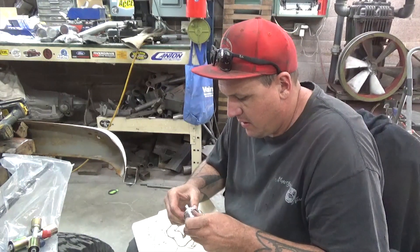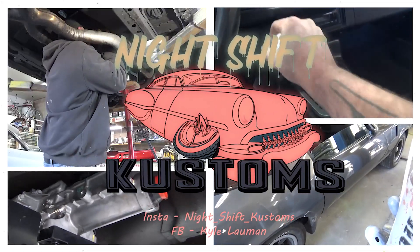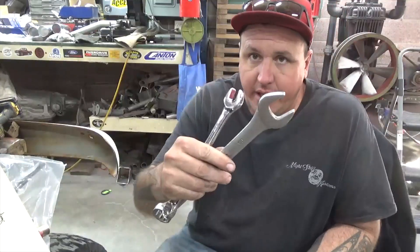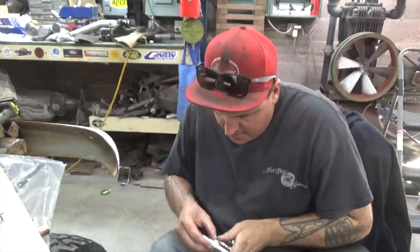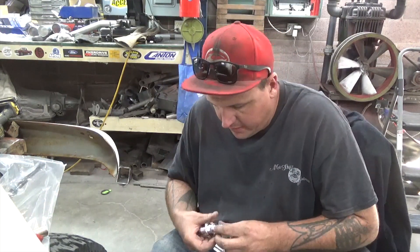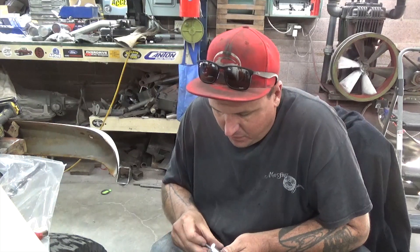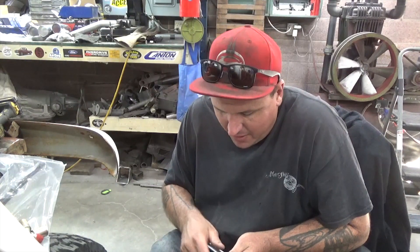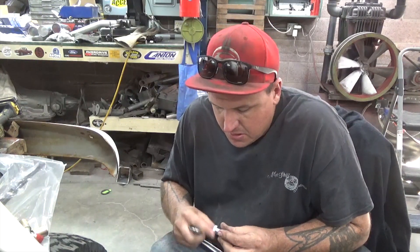Then you're going to take your one inch and your three quarter inch wrench and loosen up the nuts that hold this together. Set these on the tire and loosen them. They're the same size, that's a good start. You never know what they paint them with though. Some of the pieces are powder coated and it doesn't work for your sizes or your threads. Some of them have some terrible black paint that comes off immediately, like the black lug nuts. Of course nowadays the chrome lug nuts fall apart immediately as well. You get it down to this little guy.